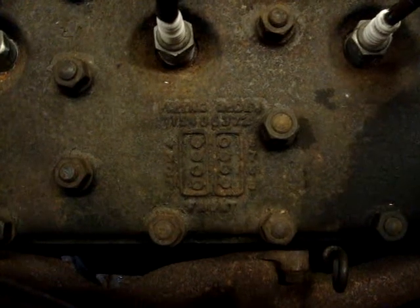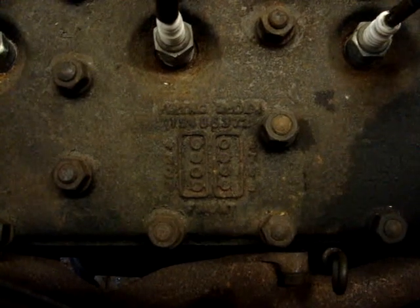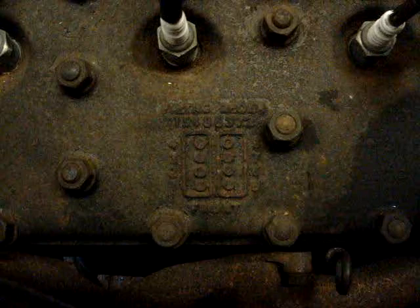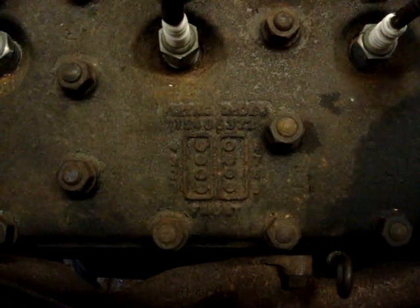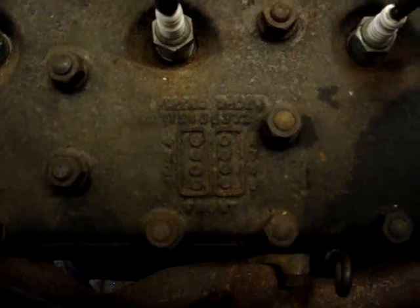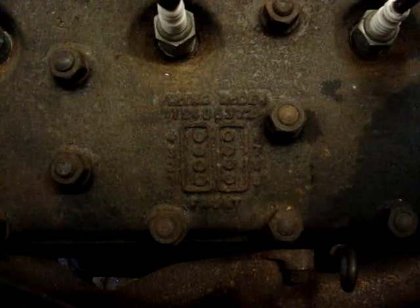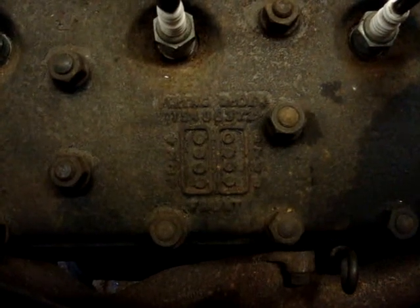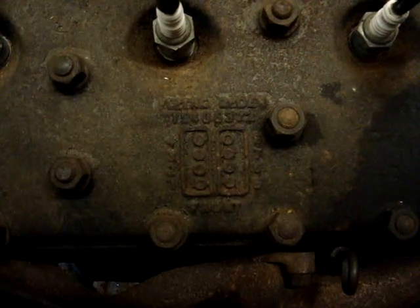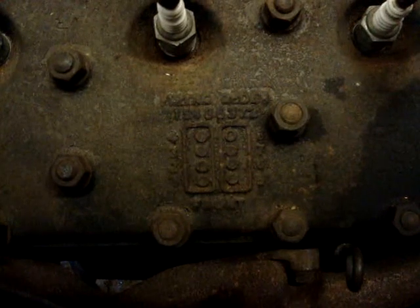If you look very carefully on this cylinder head, it tells you the firing order. What I'm going to do is show you how I — other people probably do it different — but how I'm going to work out what cylinder the engine is going to be firing on. I want it to be firing on number one at top dead centre. Now that firing order is 15486372. So when it's firing on number one, the valves should be rocking on number six, because that's like the opposite one. It's like number one and number five are sort of the opposite, so the fifth one in the order from number one is number six.